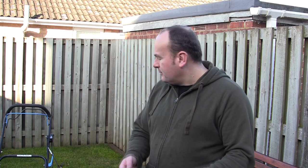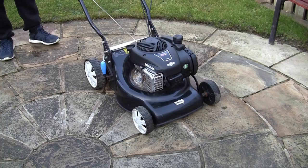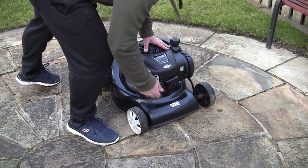I'm going to show you a few things I'll do to clean the underside off. My guess is that the belt might have come off. I'll show you which way to tip it up so you're not spilling petrol all over the floor. One really key thing - just don't turn the lawnmower right over to drain the oil or clean the underside, you're just going to flood everything and cause yourself massive problems. There are two different pressure washer attachments: a normal one and a dirt blaster which is more powerful and might take a bit of paint off, but if it's really bad it's worth trying.